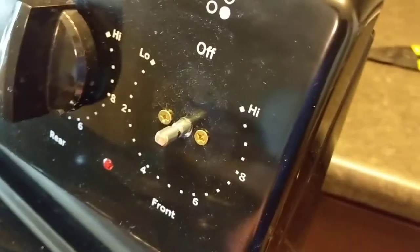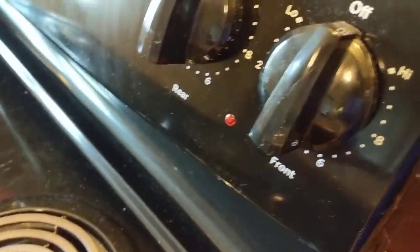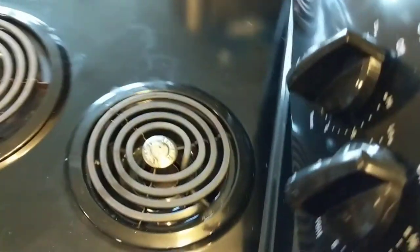It's all wired up. Now we'll put our knob back on, plug it in, and see if the light stays off. No light — that's it! Replacing the switch on a GE electric range for the 8-inch burner. So if you have your light stuck on while your switches are off, find out what switch it is. Just look where your light is, follow the wires out, and pull one off each switch. Plug it back in, see if the light goes out, and when it does, you know what switch is bad. Thanks for watching — see you on the next one.